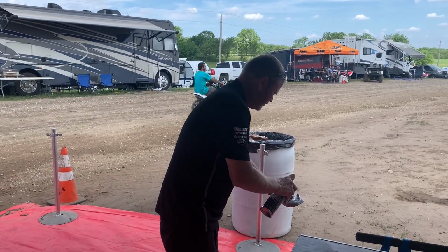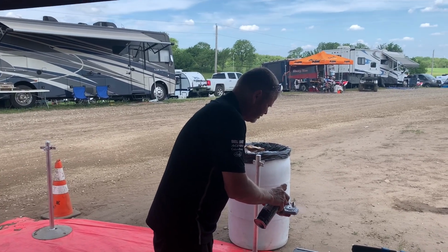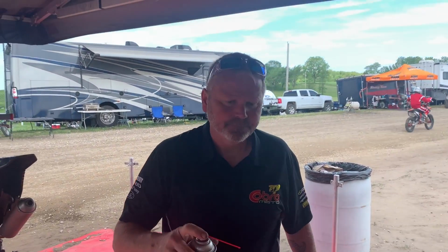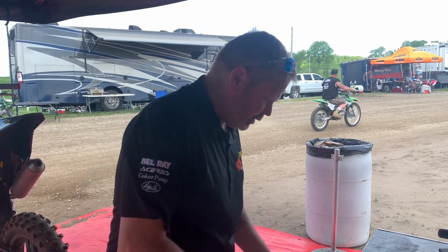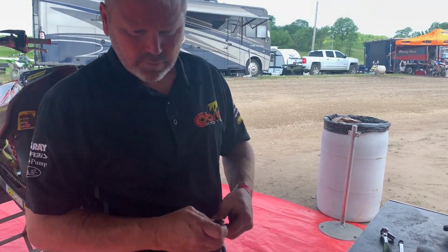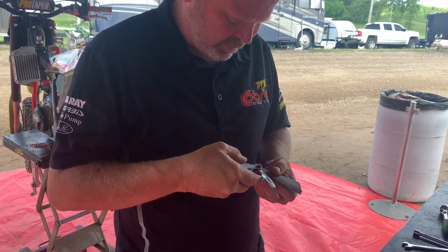And so we know this is a new cylinder, so we don't have to check it for the size. This would be an A-size piston. But if we did need to check for what size piston we were putting in this, what size feeler gauge do we put in there? I would use a 2 thou. All right, so you use a 2 thou feeler shim stock, and you put a piston in there. Tyson will give you an idea here of what it would look like.